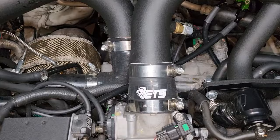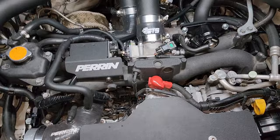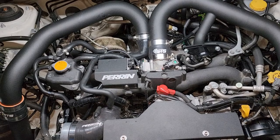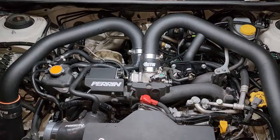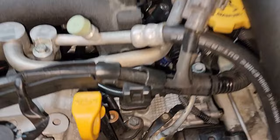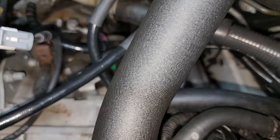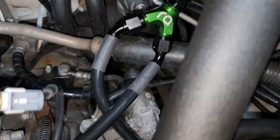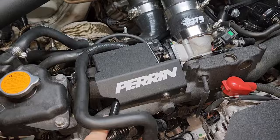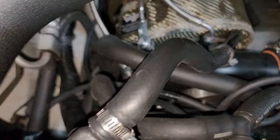I've been tinkering with this for a while. There's a lot of stuff stuffed in the back and I do not want to pull the motor apart. What I ended up doing was using two pre-made lines from the original Radium pump kit — the crossover lines from the saddle gas tank siphon setup. Both lines actually fit right in the same spot. They come out 90 degrees, run under the manifold, and up to the Radium Y. The second line, which is a little longer, actually worked out pretty good — drops down straight into this rail at 90 degrees.